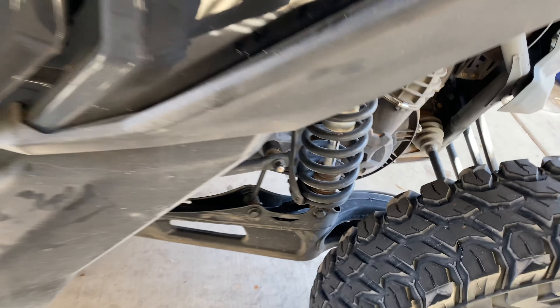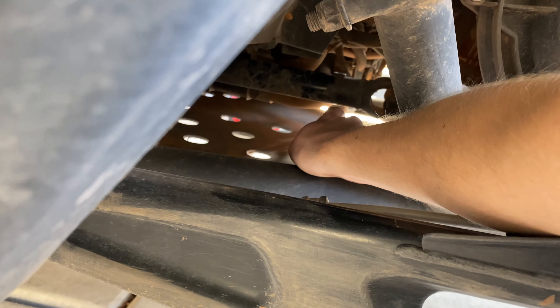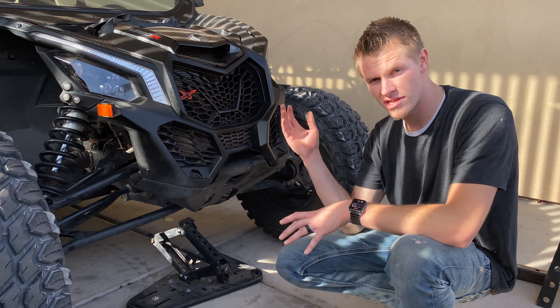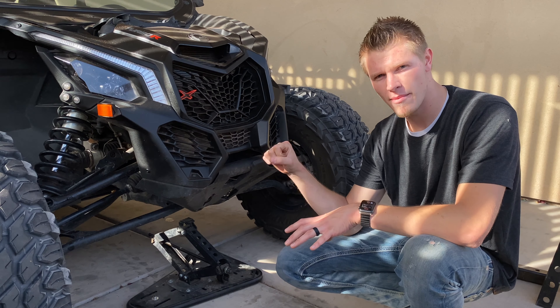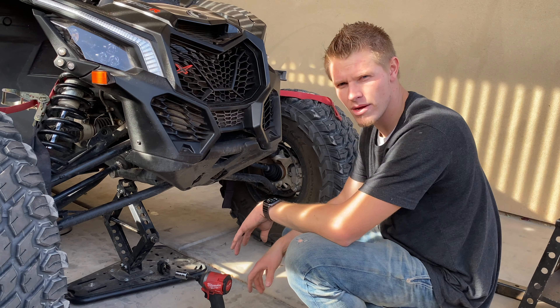You can come back down and see the driveline right here — this runs from your rear gear case all the way to the front differential. You'll grab it and see if it will turn. If it doesn't turn, that means it's locked in, so your actuator is working and it's just not spinning your front tires. When it's in four-wheel drive the driveline is locked in but your front tires aren't rotating with the differential.